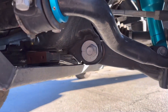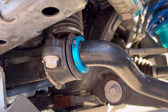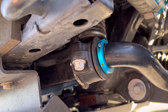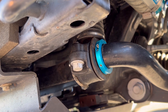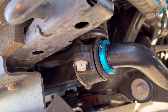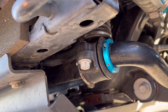What I also went ahead and did at the same time with the order from Dr. KDSS, I went ahead and did the front sway bar billet clamps. This replaced the rubberized OEM one — those were just pretty much glued on and they're not going to last a long time. What this does is it actually locks in the front sway bars so that it's dead center and it's going to stay centered. You actually have to pre-drill a hole there, but it locks in the sway bar and you're going to get better control.